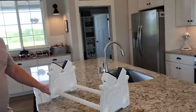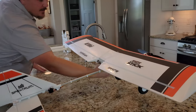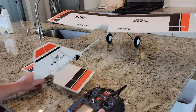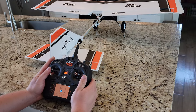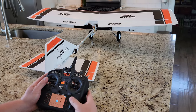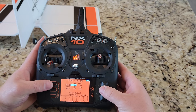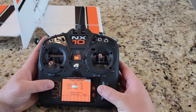Now what we need to do is figure out what else we have to unscrew that we changed. Okay. So now the first thing we want to see is flaps, because that was the whole purpose of this transaction. Okay. So flaps, they go up, they go down. Okay. They go up, they go down. They keep acting as ailerons. That's good. So now we can go down to flap system and I want to change the speed to 2 seconds, because that's usually what we like.